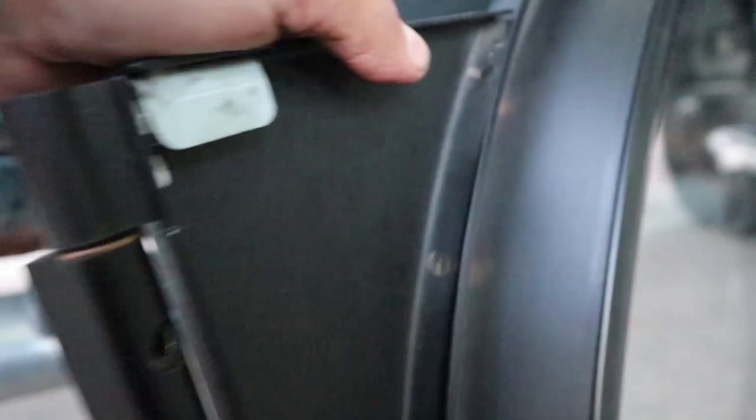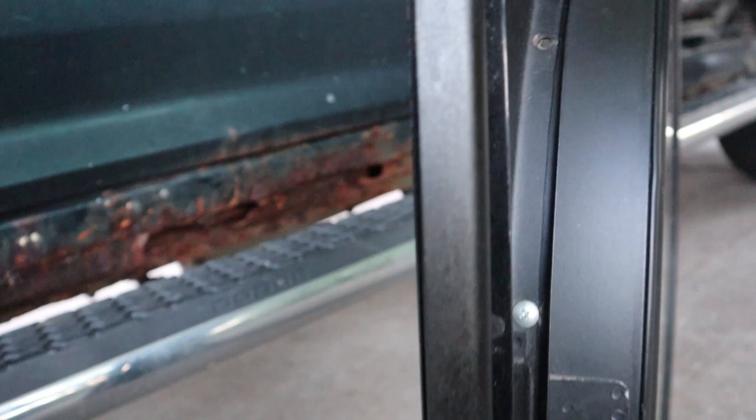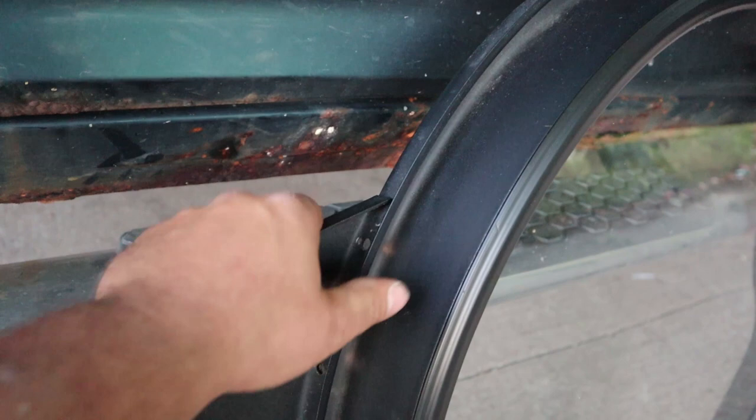Here's something. This is the back of your dryer door. This is the front. And you see those 2 holes there? You see that one's got a bolt in it, and a screw, and actually it's got a nut on the back. There should be 6 of them. There's 2 there. There's 1 missing right there. There's another one. There's 2 missing here. Now, how I noticed this was, and I'm one-handed, this metal part here, where it attaches to this, was floppy. It was just flopping back and forth.